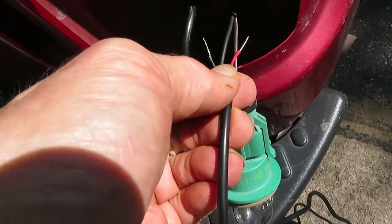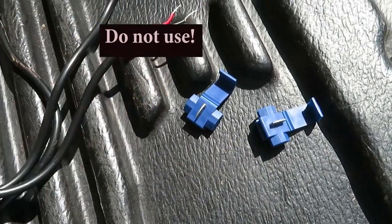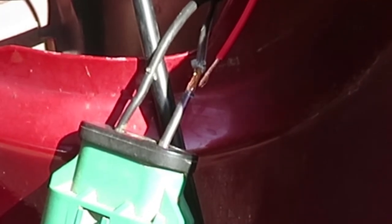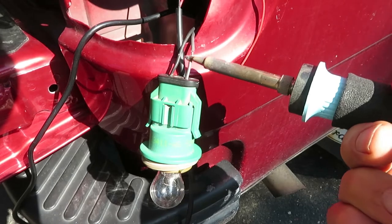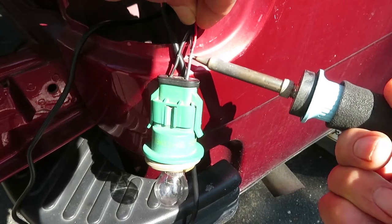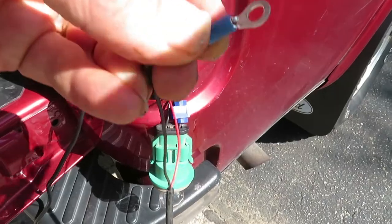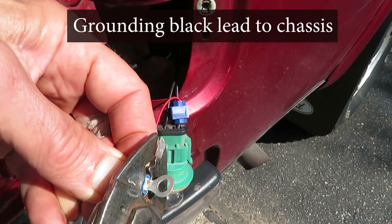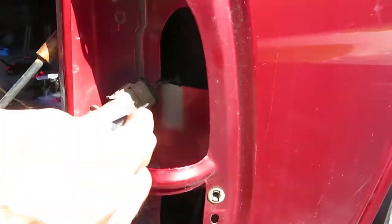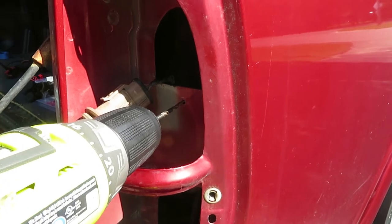There's quite a bit of extra wire. I tried wire taps but they did not work — the wire gauge is too small for them. Another option is to strip off the insulation carefully with a utility knife and then solder the two together, which is probably a better connection. Tin them both first. Found the black wire to the chassis and crimped an eyelet on it. Since I could not find a nearby place for the eyelet, I'm going to drill a small hole and put a self-tapping screw in there.